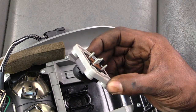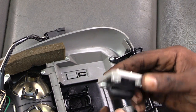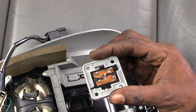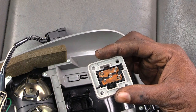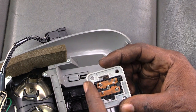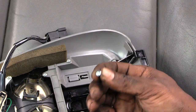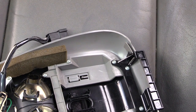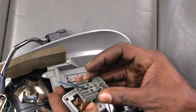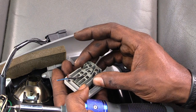This will be what you'll be replacing with a new switch. All you have to do now is go get another switch and pop it right back into this hole right here and you'll be good. This is all one piece — this is how you take out your switch just in case it goes out on your moonroof. You'll just have to remove the electrical harness, take out the two torx screws, then pop the new one straight in, plug your electrical piece back on to it like this, and you'll be done. Thank you.